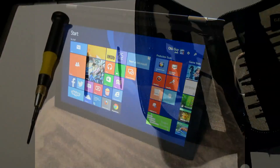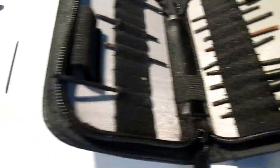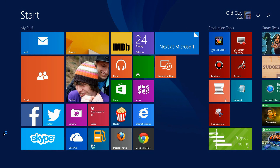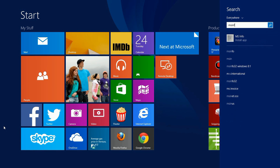Second SSDs are very cheap now. Here are the tools you're going to need: a Torx set - T-O-R-X - that's the one on the far left, used to get the back screws off. You can use other screwdrivers but the best way is a Torx set. I got that kit for about seven or eight bucks. It also has other small screwdriver tips that will be used for taking out some internal screws.